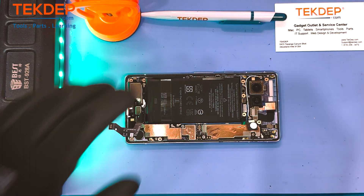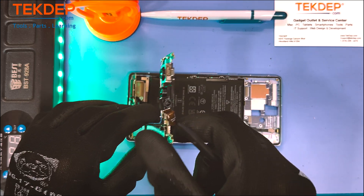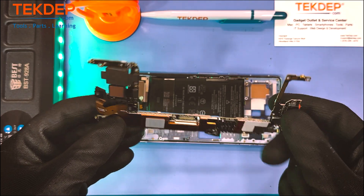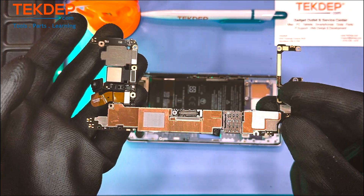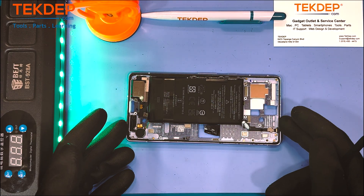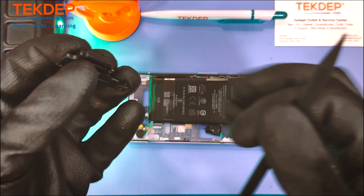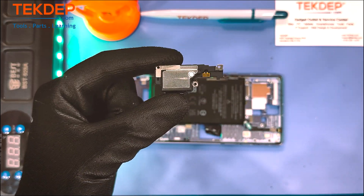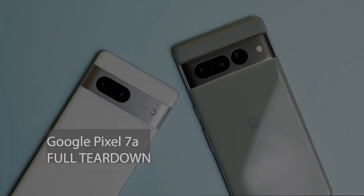That motherboard that you're seeing right now is quite delicate. This phone actually has a similar design to the iPad, but everything that can be attached — you can see that the front camera and charging port are all soldered to the board. So you really want to be careful before you pull on it to make sure that all the flex cables are disconnected. Now you can see that within the frame, all that's really left is that bottom stereo speaker — like the iPhone, that stereo speaker connects to the top speaker to form the stereo. We have the motorized vibration engine right in the bottom left, the battery, the antennas, and that's pretty much it.